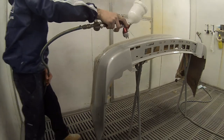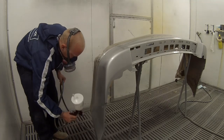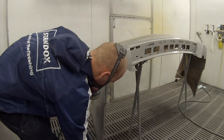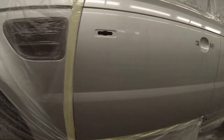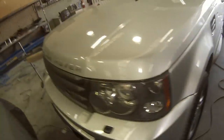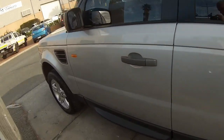This is the second coat of clear on the bumper bar. After it's all painted I was pretty happy with the orange peel — there's not much dust in it either. There might be one or two little spots. We can then bake it out for about 45 minutes at 60 degrees. If your booth goes up hotter they can take up to 80 degrees; even these plastics are okay up to that temperature. I wouldn't want to go much hotter, otherwise you can start bending the plastics and causing damage to the paintwork. As you can see it's got a nice finish on it with a nice orange peel. The colour blended out quite well. This is the car after it's been de-nibbed and cut and polished, and after it's out the front and been washed up. You can see the colour blended out over that door quite nicely.